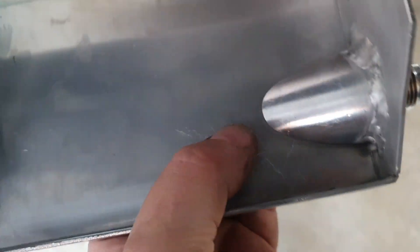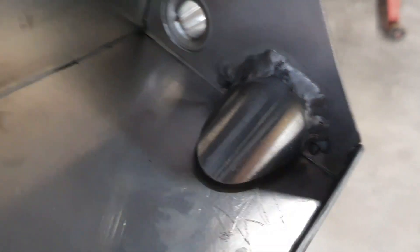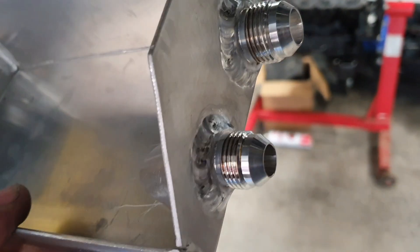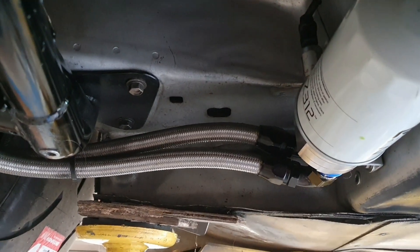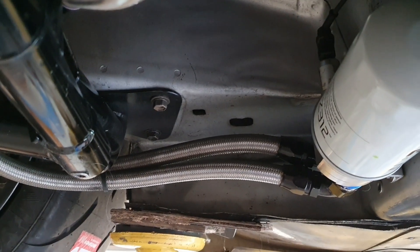This fitting next to my thumb has a nice little cover on it so it only sucks right down near the bottom. The other two fittings are the turbo drains, so they drain into here. We've got an electric suction pump that sucks out of that and puts it back into the sump. There's heaps of space here — it's over at the left of the car, as far forward as practical, quite low down, so CG and all that is favorable.